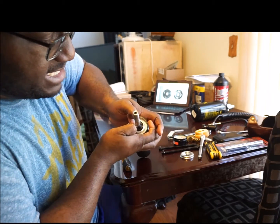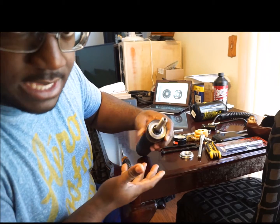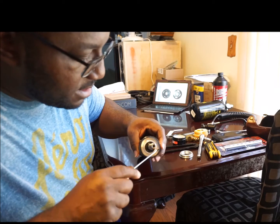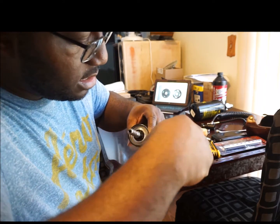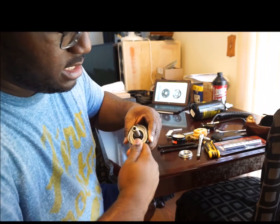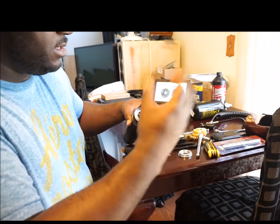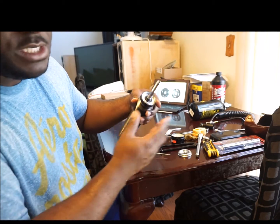What I'm going to do is push down on this to get access to the c-clip. Now that it's not pressurized, I can push down and get access to that c-clip like this. You want to be delicate and gentle if you can, and get it out. Now that I have it out, I have full access to lift this whole shock shaft out — be careful because oil will spill as you do it.